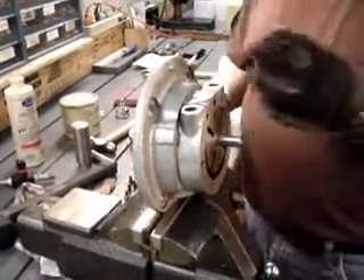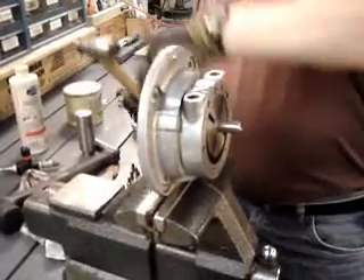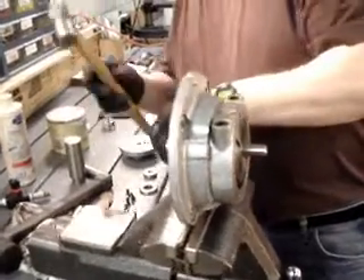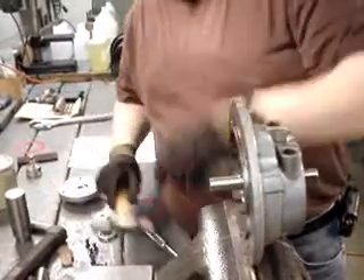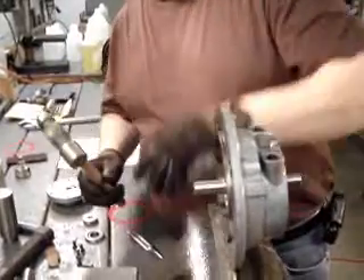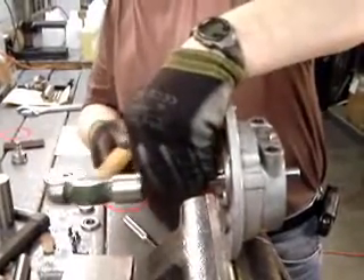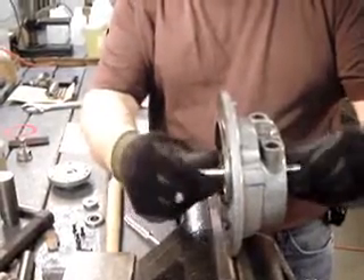I have a little stud that I use with a ball peen hammer and I go over here to the drive-in side of the rotor assembly and I just give that a little tap like that. And if I need a little bit more, just repeat those steps until we're able to move that.